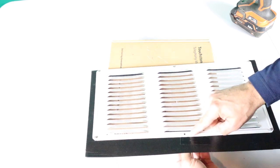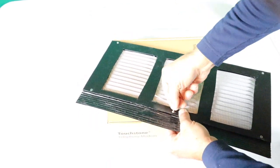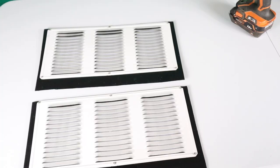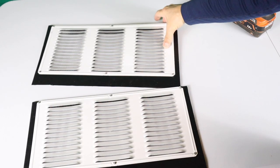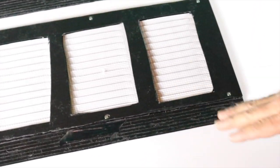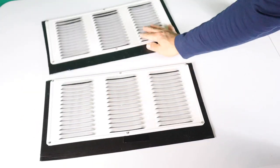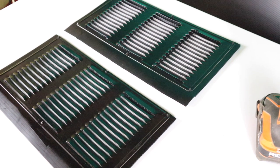I drilled pilot holes in the plastic panel and secured the vent to the panel with small bolts. So I now have two panels, one for each side of the Jeep. There's the front, and on the back you can see the removed piece at the bottom which acts as a skirt, as I'll demonstrate shortly. There's the two vents, and of course you can spray paint them to your color of choice.